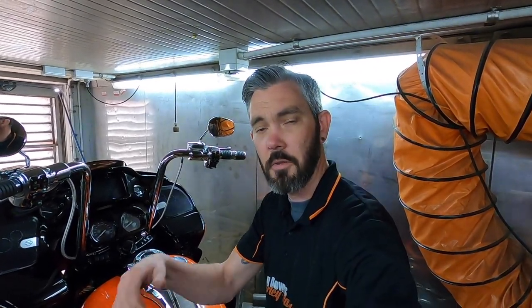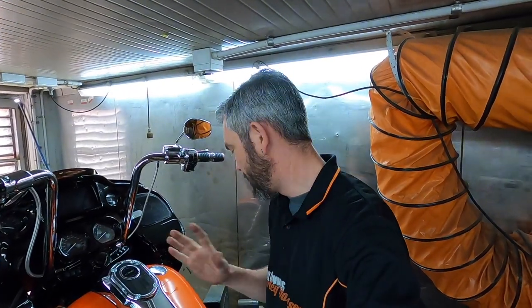All right, she's all ready to go. I'm just going to load the tune in from last video, the 131 with the full sack header, same camshaft for that. So this has just got a little bit different air cleaner, and obviously the header pipe's different, so it'll just take a little bit of tweaking on the tune there just to make sure it's all right. So it's just up on the dyno for that.